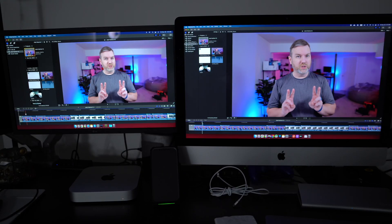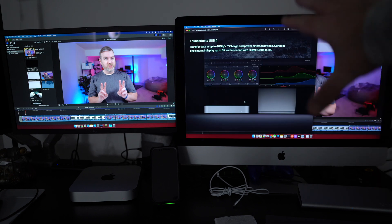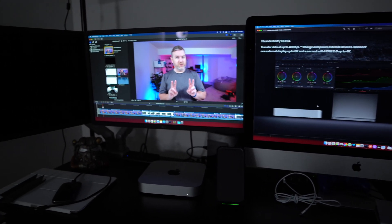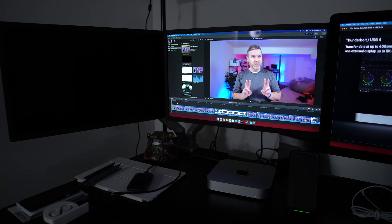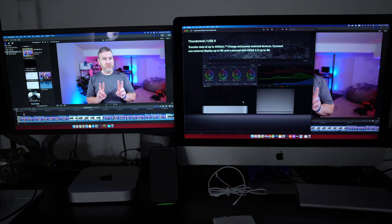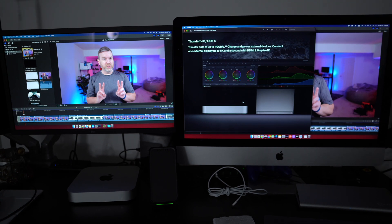And we're back the next day. I've gone ahead and gotten the Mac Mini set up — you can see it right down here alongside my 2017 iMac. Before I go any further, a very valuable lesson learned: on the Mac Mini M1 page on the Apple website, it states you can connect one external display up to 6K via Thunderbolt and a second using HDMI 2.0. I have two identical LG UltraFine 24-inch 4K displays that are USB-C only, and only one of them is working. I've tried daisy-chaining and plugging both into USB-C, but one display has to use HDMI — and these LG monitors don't support HDMI, so I'm out of luck there.